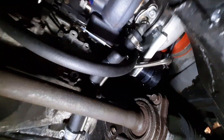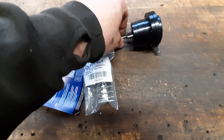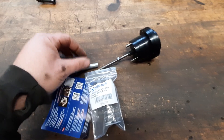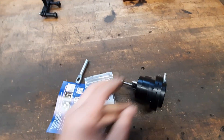We're going to try and take this wastegate actuator off, which you can just about see there. The actuator is off the car - I had to take the eyelet off to fit it through the hole. We'll undo these six fittings here and then see if the spring fits.